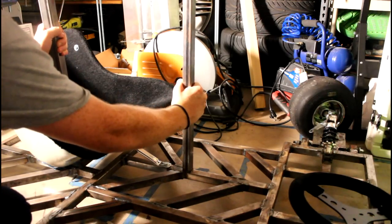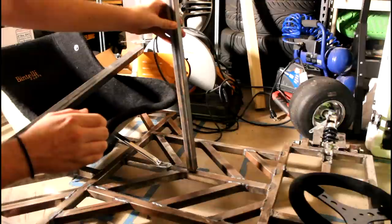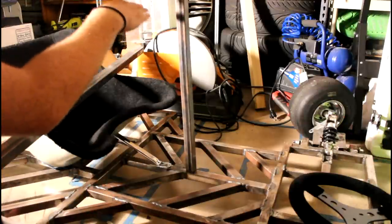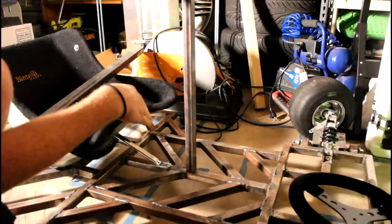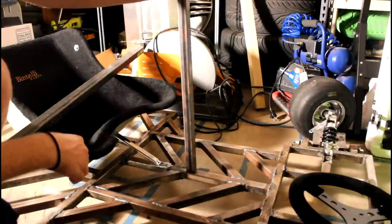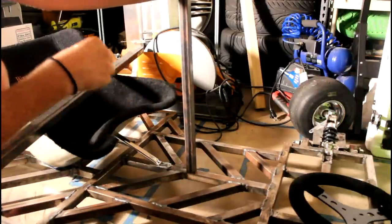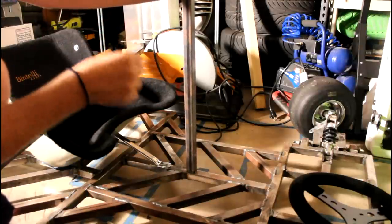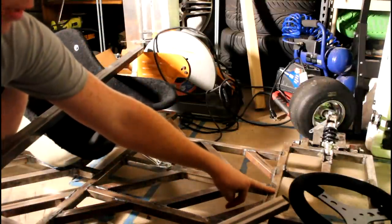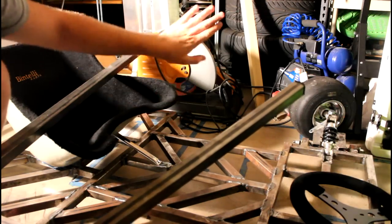This inner pipe will be as tall as I want the steering wheel column to be. Once I do that, I'll get an approximate height based on sitting in the seat, then cut it. I'll probably cut it at a diagonal at the top based on the angle I want. Then I just have to weld — I bought some three quarter inch outside diameter pipe, so that's going to fit the steering wheel hub and the U-joint I bought for the steering column. Then I need to get some other pipe that's three quarter inch diameter on the inside to act as a sleeve, and the steering wheel column will rotate inside it when you turn. I'll build another mount at the bottom, and the U-joint will be right there. When I unbolt this section, it'll allow the steering wheel column to collapse down — that's what the U-joint is for.